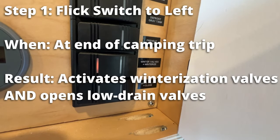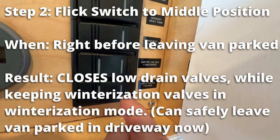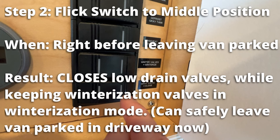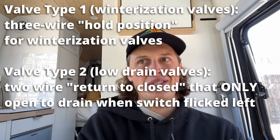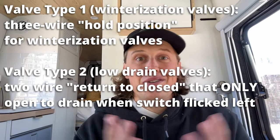Lastly, I have a bonus tip — it's not a whole new feature but a combination of the last two features that adds even more convenience to the winterization process when you get home. The auto-winterization feature that controls the two ball valves is on a DPDT switch — dual pole dual throw — which has three positions. Flicking it all the way to the left activates winterization mode: closes off the water tank and opens up the air valve. The middle position cuts all power and leaves the valves exactly where they were. Flicking it to the right does the opposite — opens the water tank and closes off the air valve so the water system works like normal. Using two different types of motorized valve on one switch gives a full complete winterization system.